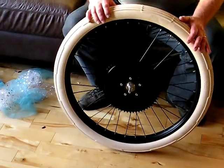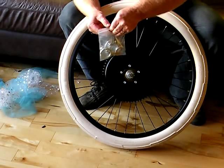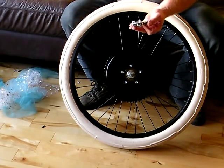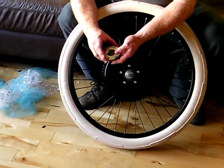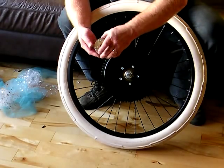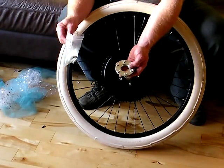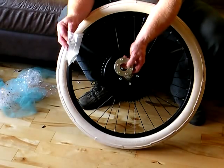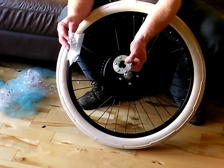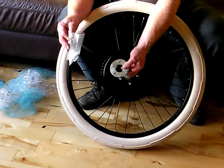Except for just the extra weight of the engine kit added to your bicycle. The other type is the HD axle kit in the solid version. Instead of bolting to a freewheel, it will bolt to a solid piece and the sprocket threads on and stays solid. You would use this if you have a two-stroke and do pedal start, or if you use an EZY kit, which doesn't have a freewheel.